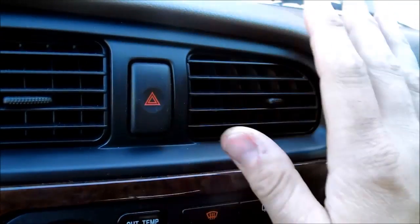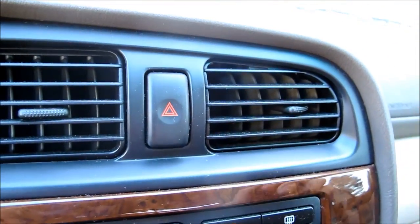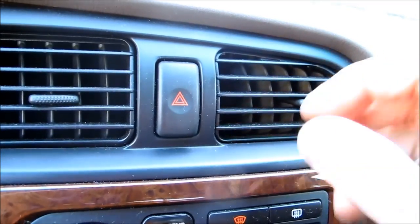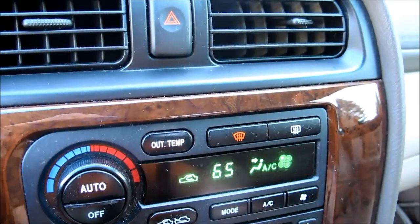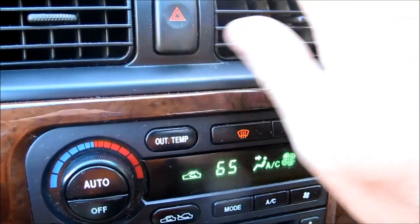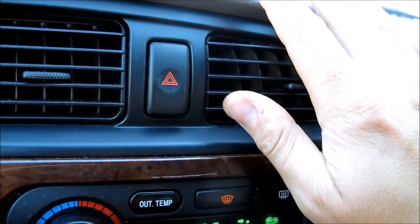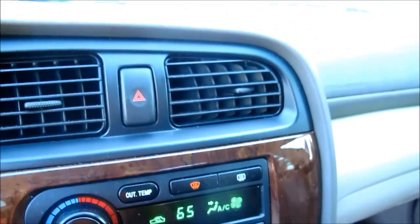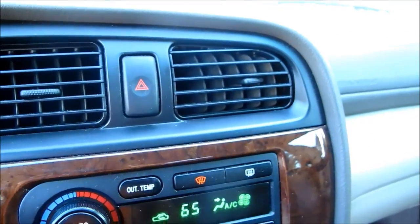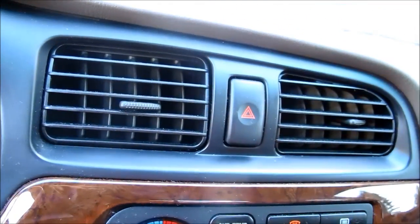Cold. You can see it's not quite full enough. That whole can's in. The system was empty, so I kind of figured it was going to take a can and a half. But putting on AC high, max fan, putting that can in, it's definitely colder air than what was blowing before, and the compressor's on. So I'll have to get another can, the same brand, and I think you can get the can cheaper if you don't want the hose and the gauge, and just top it off.